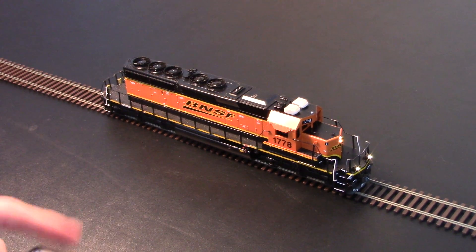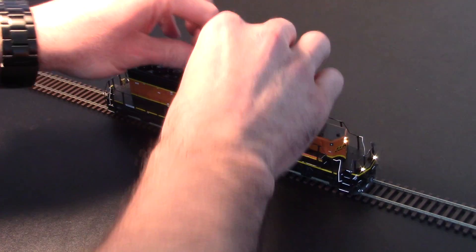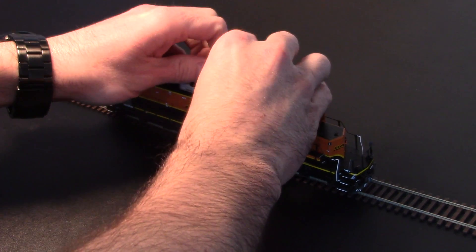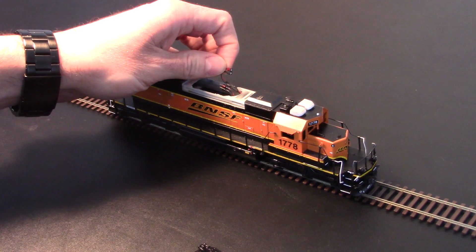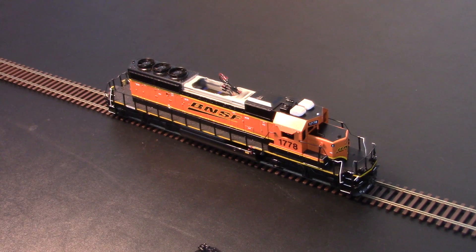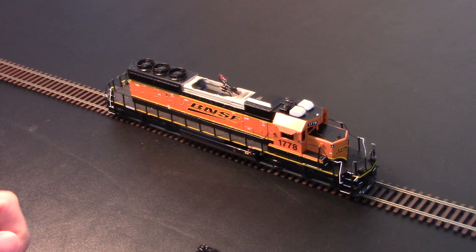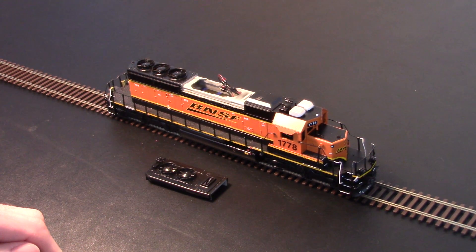Which brings up charging. When this needs to be charged, the hatch comes off, we unplug, and then into this plug here I will plug the charger, which is a USB-based charger — it goes right into my computer port. And it charges on a trickle charge. It takes a little bit of time, but it doesn't overcharge. So I don't anticipate ever having to remove that battery. If I ever do, it's fairly easy to get up underneath that fuel tank and remove it, but that one should last me for quite some time.